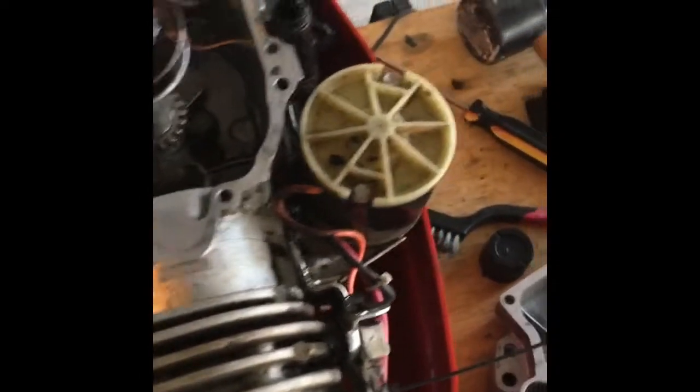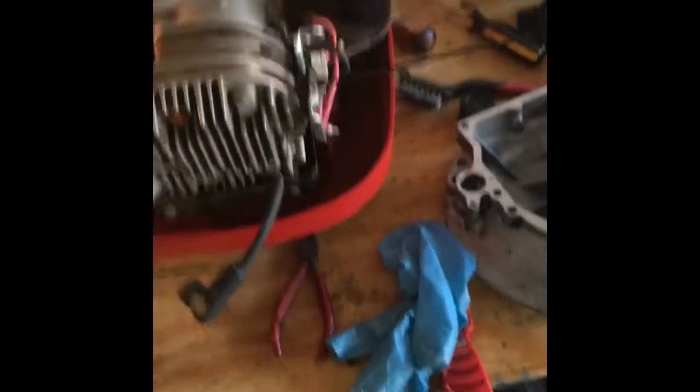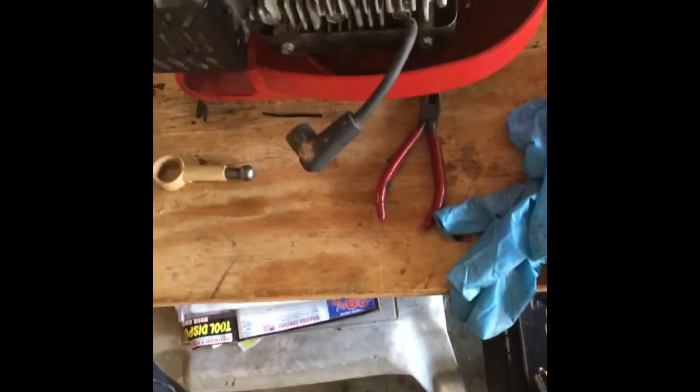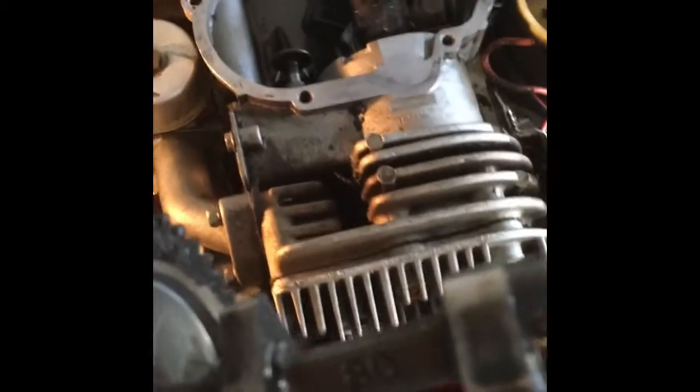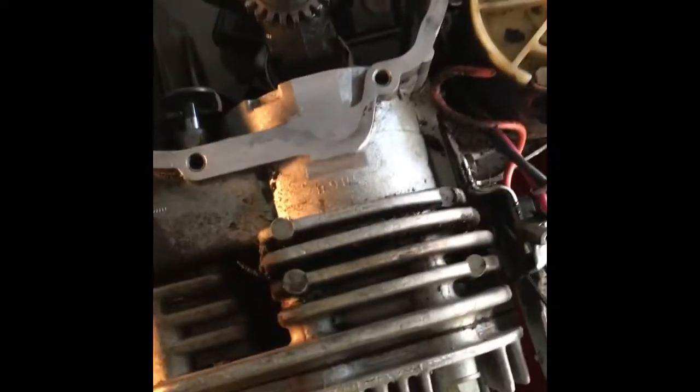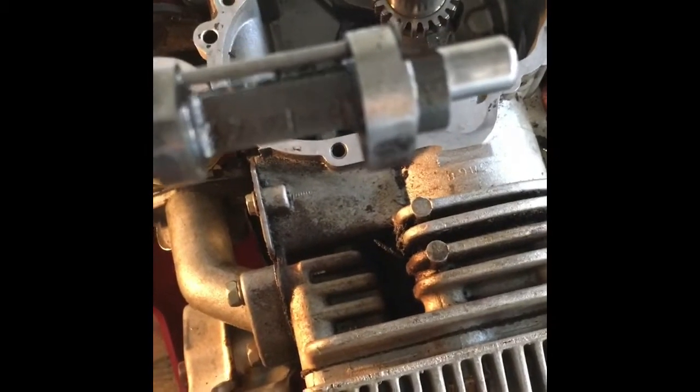Hello Tubes, back here again. I was cleaning out the inside of this, stripping the gasket off, and some of the gasket got back in. I'm going to have to put the cam gear back in. Just something I noticed — this is the Tecumseh engine. The cam is metal. In a Briggs this is plastic, except for the actual gear part — that's plastic on a Briggs. But these lobes here, which push these tappets up to control the intake and exhaust valves, they're metal. On Briggs they're plastic, and I think Honda too.